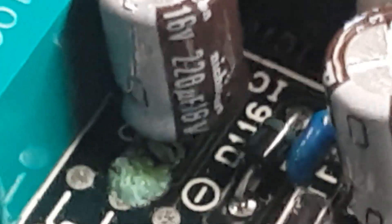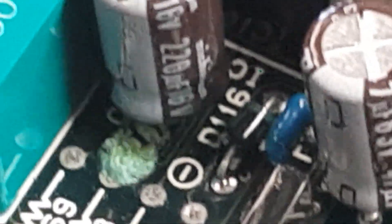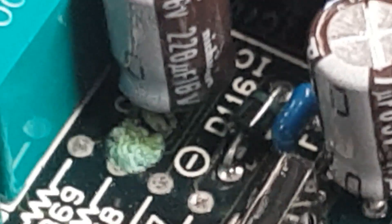Other capacitors are over here. That one looks okay. And that one - there's a big bit of gunk which I can see in the camera. So definitely time for a repair, very simple. We'll replace the capacitors and hopefully clean that board, and we'll cross our fingers that it's going to come up all good.